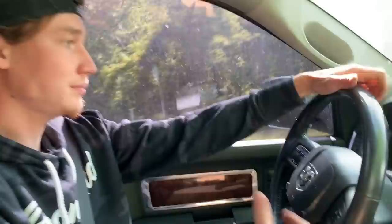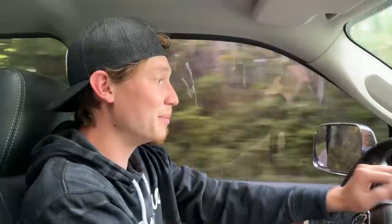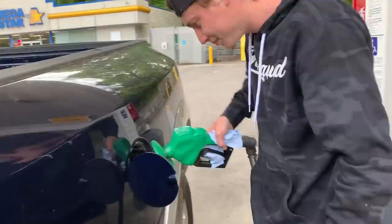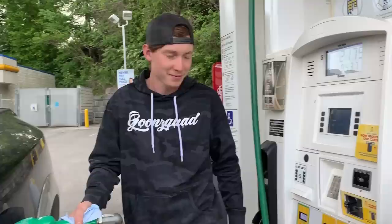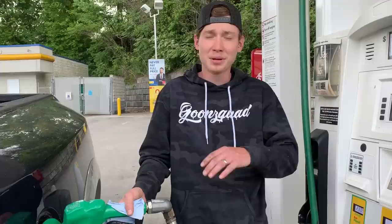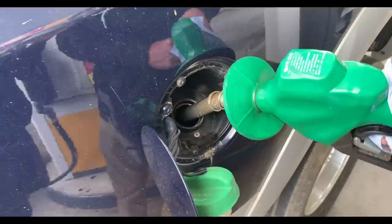All we need to do is add some diesel, which we're about to do. I'm noticing the coolant temperature is at 177 — normal is probably around 200, so we're under 200 right now. We'll see if it goes anything above that. We're past empty — I'm surprised this truck is still going, but these Cummins just keep on ticking. We made it to the diesel station and filled up — fuel is pretty cheap right now, two dollars and thirty cents for diesel, a dollar fifty-four for gas. We noticed our fuel level gauge is not working — we put nine gallons in and it's still showing empty, so we probably have a wiring issue. Heading back home to figure it out.